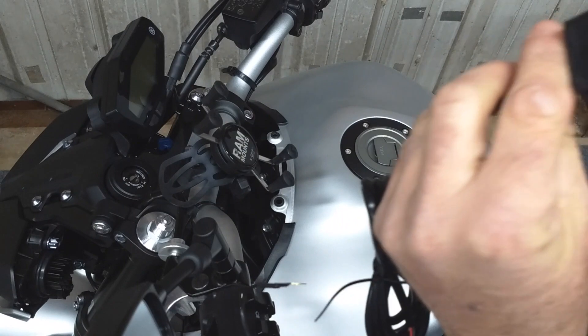Here on the side of the bike — this is the right side — we're going to remove this cover here. Just one allen head bolt right here and two push pins on the inside. On the inside of here you can see the plug — that is the accessory plug. I've also pulled out two more push pins on the inside so that I can get a little room to pull this out. I managed to pull it out from the outside.